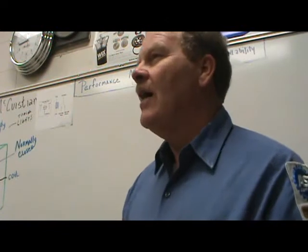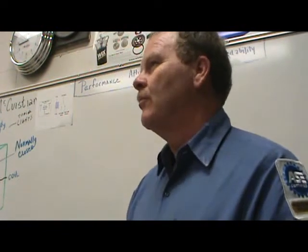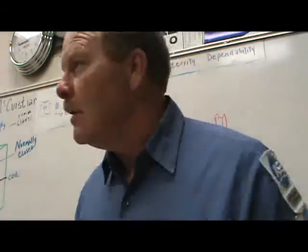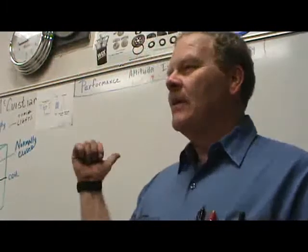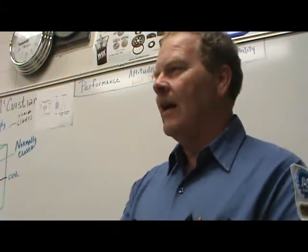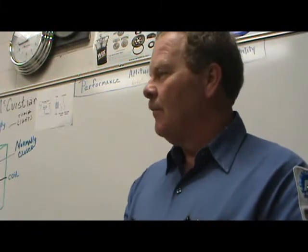And I'm really supposed to teach you guys to ream ridges as an ASE task, but I don't have any ridges to ream. You know what I'm saying? I guarantee you could feel the cylinder walls on that when you pulled the head off a Honda. It ain't got a ridge of any kind. Why did they do that?